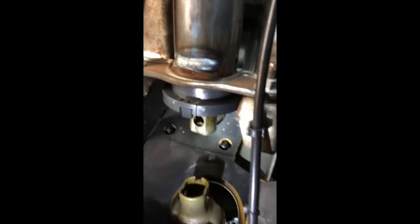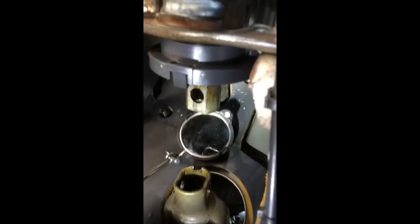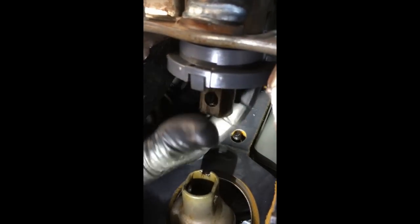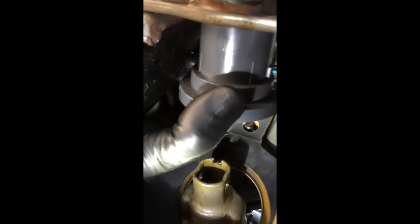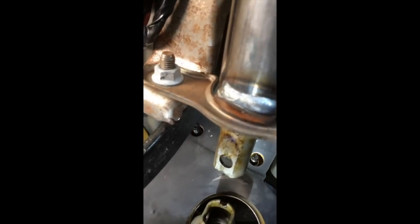Let's go ahead and install it. Back under the dash to put the new one back on. Since this kit came with a new cage piece, I'm going to go ahead and replace that as well. We can see what it looks like with the mirror and how the piece fits together inside. To remove the cage and bearing, you just grab on it and give it a pull — it will unsnap internally and slide off. I'm only replacing it because I have the new one, and it's been on there since 1998. It's the same part number and style as the one in the kit.